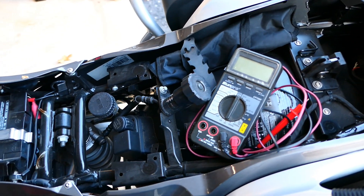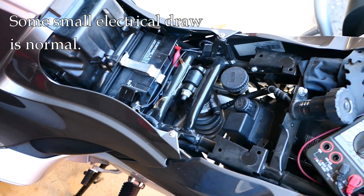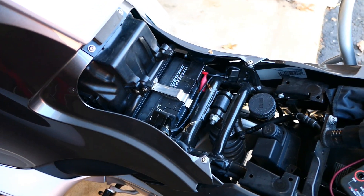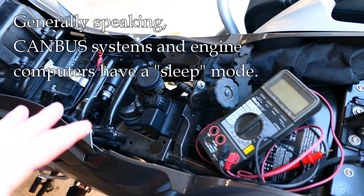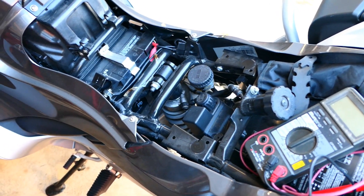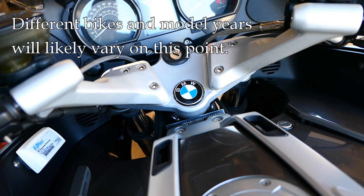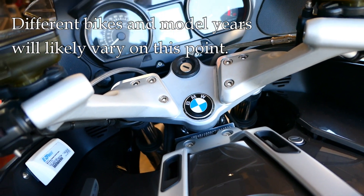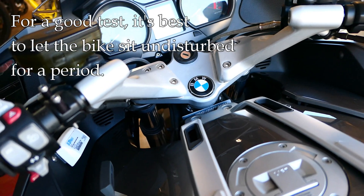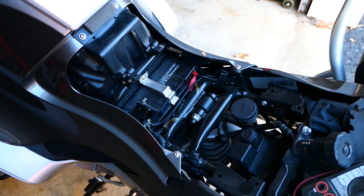With the CAN bus system there are a couple of things to be aware of. There is always some electrical draw because it needs power to monitor its system and keep memory even when the bike is off — that's normal. The other issue is that we want the ECU to be asleep when we're doing the testing. If you turn the key on you'll wake up that system, and it'll take maybe 10 to 15 minutes before it goes back to sleep mode. The bike should be sitting for at least an hour without anything being touched.